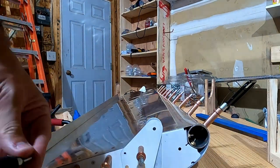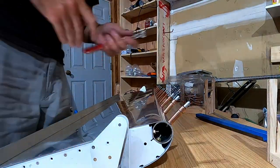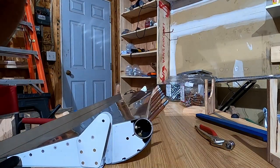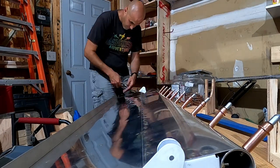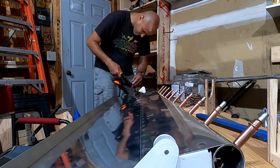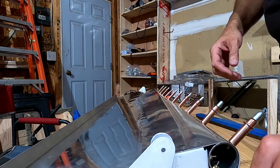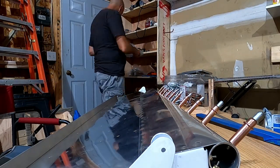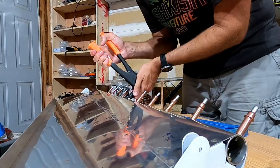I must be going down to the workshop in the basement to grab the right rivets. They're flush pop rivets on the end, dash-four size for a number 30 hole. They're not like the MK319-BS that we would use in a number 40 hole. I don't think CS4-4s are structural whereas the MK319-BS are — I'm not positive on that, but I don't think they need to be structural in this application because the trailing edge is gonna be held together with solid rivets. So these are just additional hold-it-in-place, line-everything-up rivets.